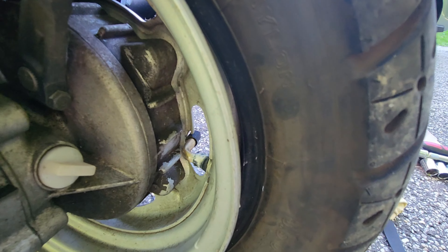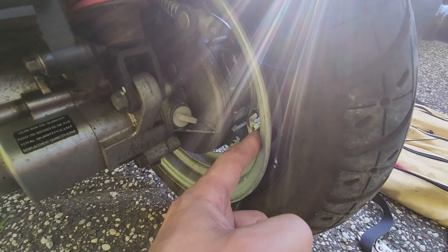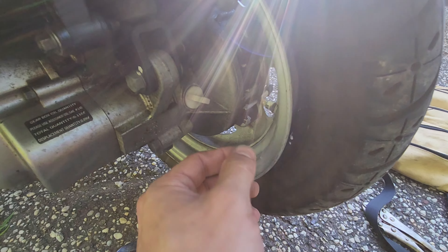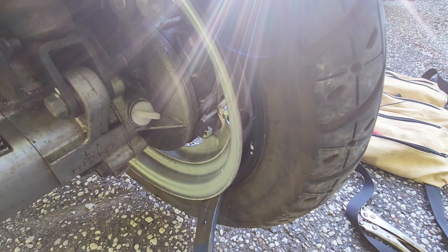We do have some white lithium grease on there as well, and it just slicked right into place — very simple to do. As this is a 90-degree angle, you don't really have anything to pull on as you're trying to push in, so I just put some pliers on there, gave it a rotate, and it popped in first try. About 15% as difficult as yesterday — the freezing absolutely works. And there are two of them; this one failed, so it's just a matter of time until the front one fails. So I'm going to swap them both out.